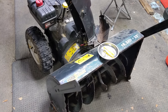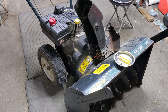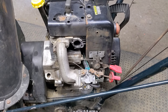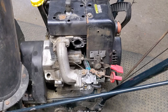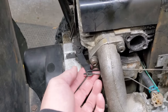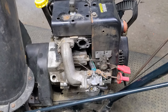Today in the shop I have a Yardworks 10.5 horse 29 inch snowblower. This has the HMSK105, so 10.5 horsepower. This snowblower came into the shop with a couple different issues. The first was it did need a carb clean and rebuild because it was running quite rough. The customer also stated that it was running at too high of an RPM, and he mentioned that he tried to take the carb off and redo the linkage, but unfortunately he wasn't quite familiar with how these engines are hooked up. You can also see that the muffler is missing, so that's another issue.